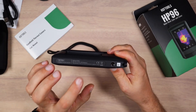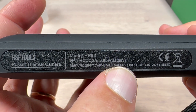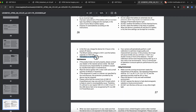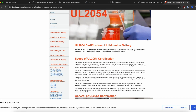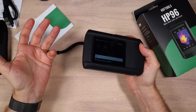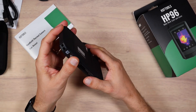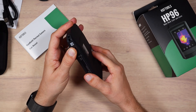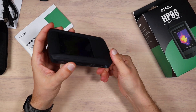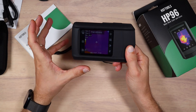According to the documentation, this device is made in Vietnam and has a built-in 3.8-volt 2100 mAh lithium-ion battery, which should provide four hours of battery life based on manufacturer claims. The documentation also states the battery is certified by UL2054 standard, but as I don't have access to actual certificates, I take such claims with a grain of salt. The camera has a built-in flashlight and a rugged body with an IP54 rating that should keep basic dust or small water splashes from damaging the device, but definitely won't stand against water submersion — so keep that in mind in extreme work conditions.